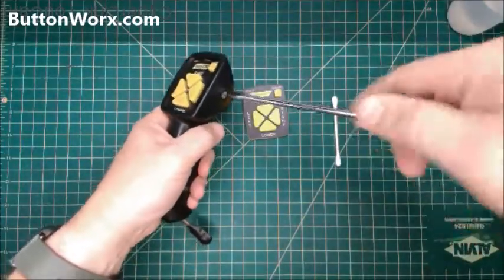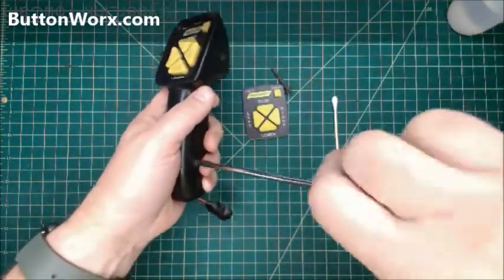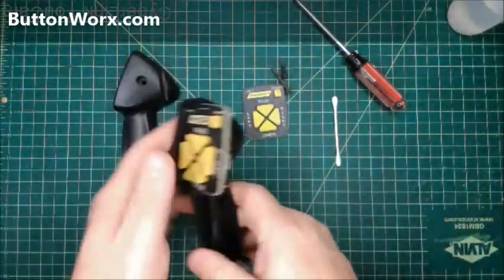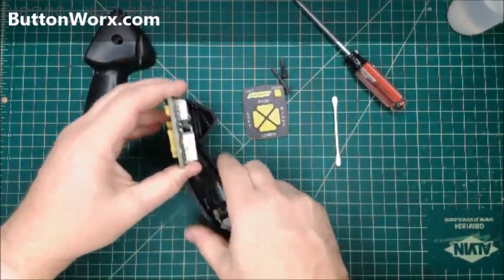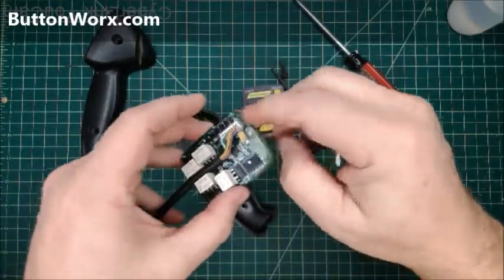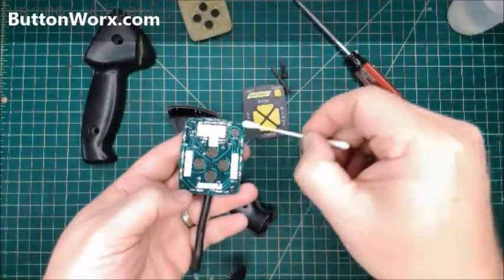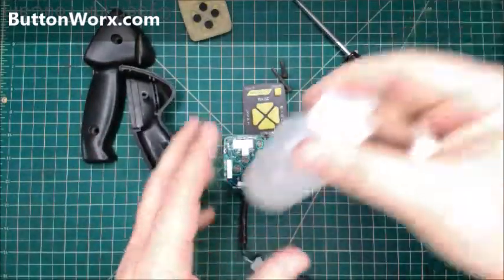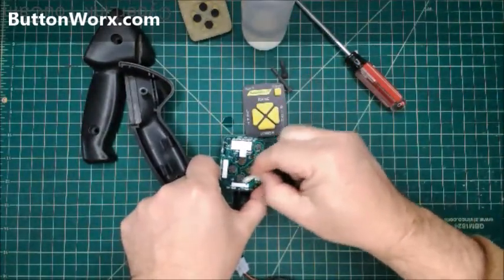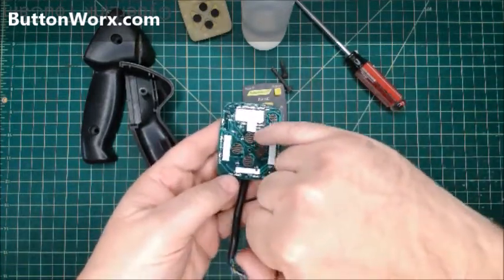What you do is take the two side screws out — there's a long one and a short one. Whether your keypad's buttons just don't work that well or they're ripped out or whatever, this will take care of any problems with the buttons. Pull out your unit — the original one is held in with these little rubber tabs, so you just pull it and it comes right off. If you're having trouble with your buttons, there's probably a bunch of black goo on here that you need to clean up. Just dab a Q-tip with some isopropyl alcohol and clean up the black goo. Some keypads have gold contacts and some of them are black.